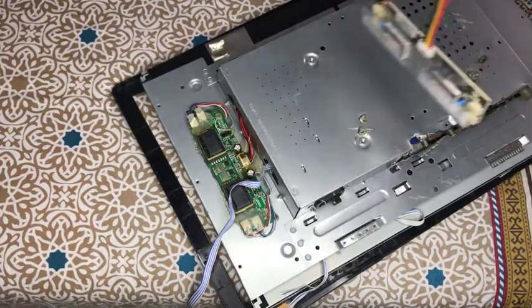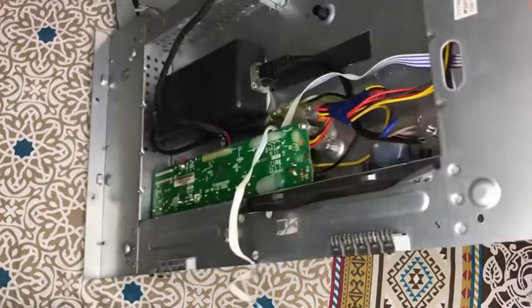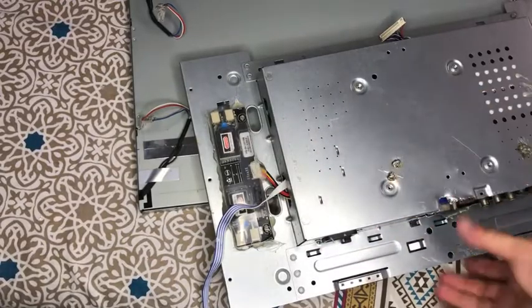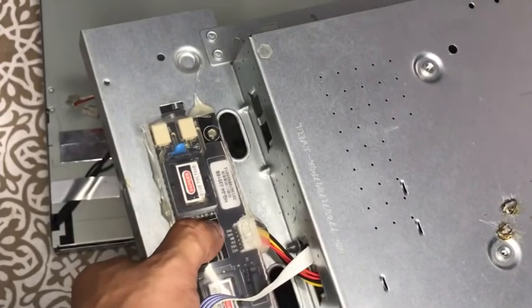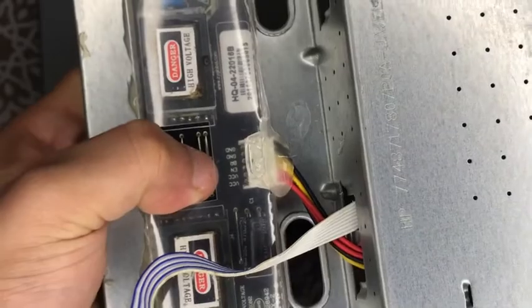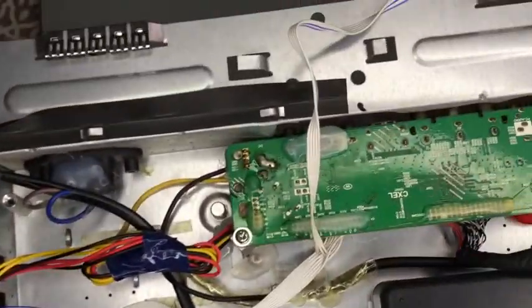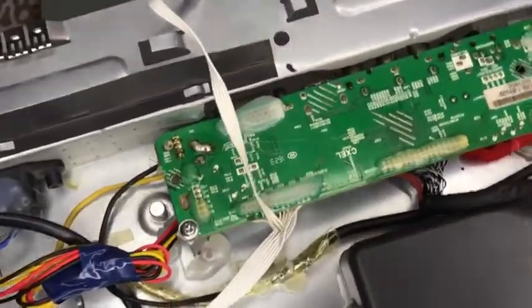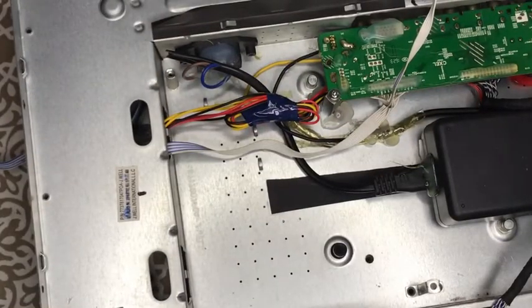Now I will remove it from the cover and the connections. I have put in the new lamp card — this is a basic and simple way. First, check the connections: it is written on both the universal board and the lamp card. The two ground pins come first, then ADJ for brightness, then on/off, and then two 12V pins. Inside the wiring you can see the panel sensor, the LVDS jack, the power supply at 12V, and the lamp card. This is the old lamp card — the same type — but it was bypassed in the first week and then burnt out.